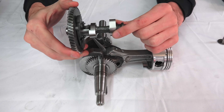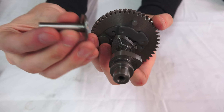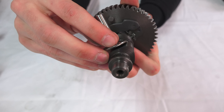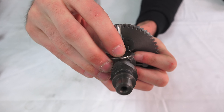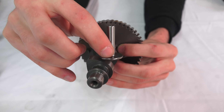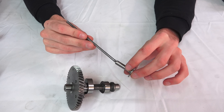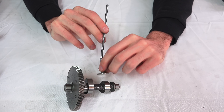As that crankshaft rotates it forces this camshaft to rotate, which has lobes on it that are going to be opening and closing the valves. We have a cam follower — you could also call it a valve lifter or tappet — which follows that profile of the camshaft. As the camshaft rotates it will force this lifter up, and then as it continues to rotate the lifter comes back down. The tappet is what moves the push rod up and down.